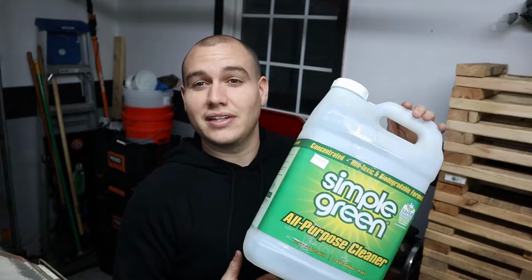I'm not a huge fan of Simple Green. I always feel like it leaves a little bit of a residue on parts, but again, just me being honest with you, this is cheaper than pretty much everything else. This is 20 bucks for 2.5 gallons. There's a big Zep container that's like $35. In my experience with the orange citrus stuff, it leaves a white film on everything. And if you leave anything in there to soak, it oxidizes really fast for some reason, so I don't normally mess with anything orange citrus because it kind of ruins stuff.